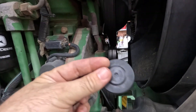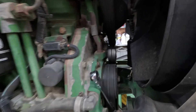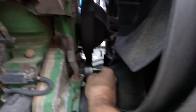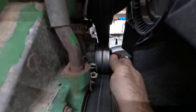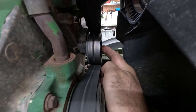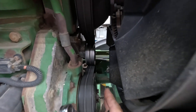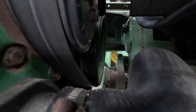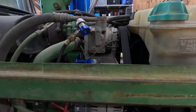One thing I want to show you — there are these caps over these idler pulleys. This here is your tensioner. You've got to pry that cap off; it's super easy to get off with just a screwdriver. And you've got a 15 millimeter bolt. Generally on the 6210, you want to pull it up — put the wrench on there, go up, and as you can see it loosens the belt. Then you take the belt off and remove your AC compressor.